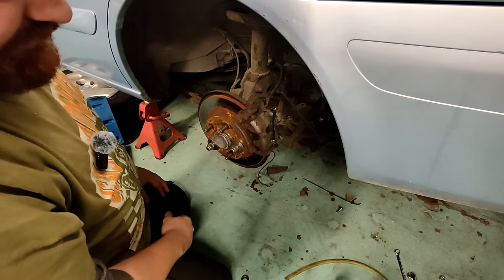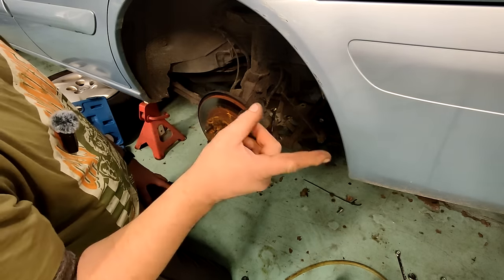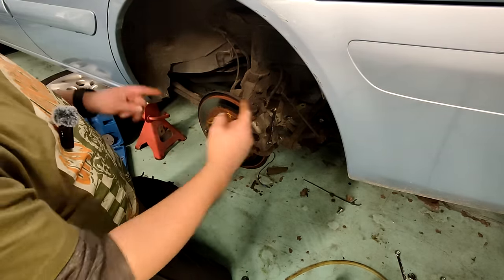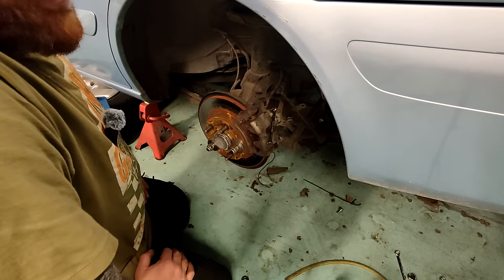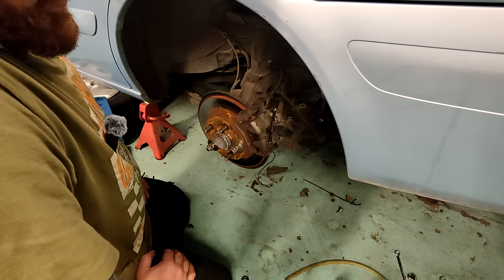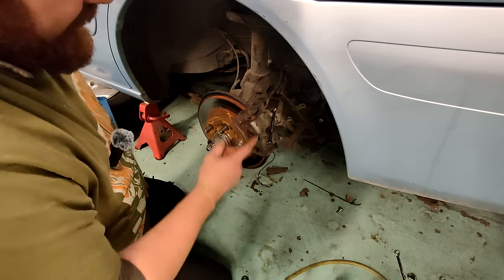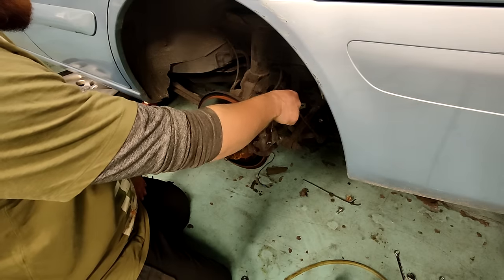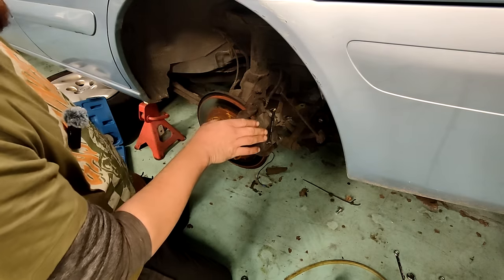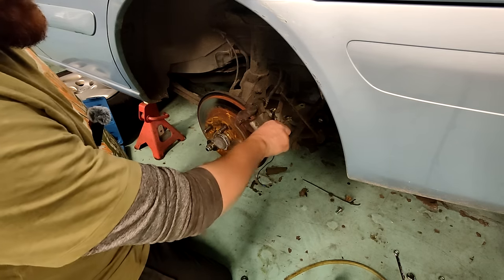I'm not even gonna put the pipe on this. We'll just get a little bit of fluid if my suspicions about the hose or the master cylinder or the pump are right. Well, it won't be the master cylinder because the other side's not doing it, unless it's got its own circuit for each brake at the back from the master cylinder, which is unlikely. It might have it from the ABS pump, but it won't have it from the master cylinder. Well, very unlikely to. I could just get off my arse and go and have a look, but I'm going to stick with my principles. Yeah, if I undo this and a load of fluid goes and I can turn it again, which I don't think will happen, that would suggest it's a hydraulic problem, but I think the issue is the interface between the pads and the caliper. So let's try it.